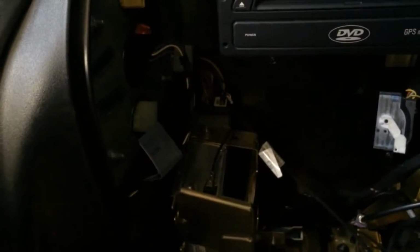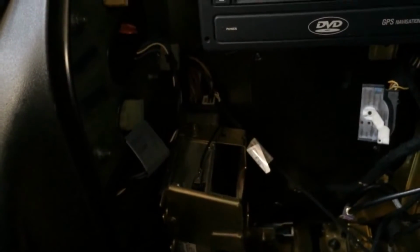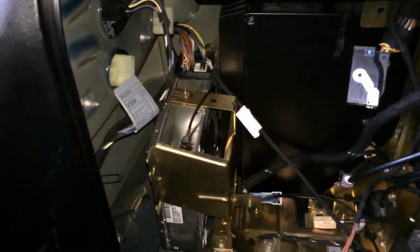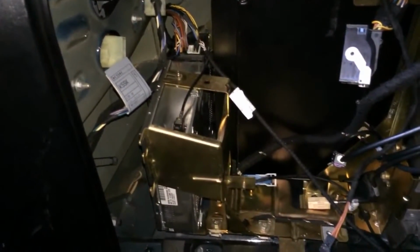Now, in my case, because this was produced before September of 2002, BMW did not pre-wire it for this. So what I actually had to do is, it doesn't matter which connector you buy, they're the same part. There's 3 wires that run into the connector, and you're going to have to take out the 3 pins from it, and you'll have just 3 cables, and those cables plug into the radio module. Now, as you see, it connects straight into it, and I'll put another link in the description with a diagram of the different pins that correspond with the different features.